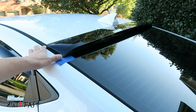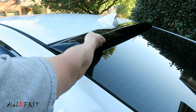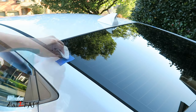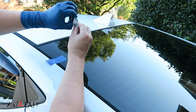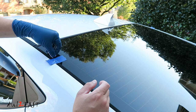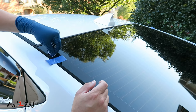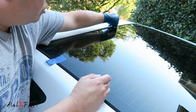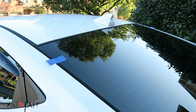I went ahead and put a piece of tape here so I know how far down it goes. Next I'm going to clean the window — make sure the surface is clean. In this bottle I have some rubbing alcohol. Take out the adhesive primer and then carefully apply this on the edge where the 3M double-sided tape will touch. Then let it dry for 30 seconds.